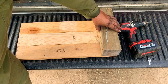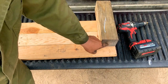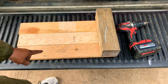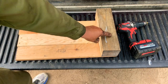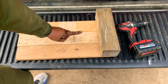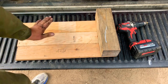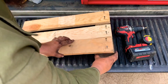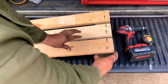What we're doing is screwing these three pieces of wood onto the four-by-four so it covers completely over them. This creates a platform where the tire rolls over and once it touches the four-by-four, because it's attached to the base pieces, it's not going to slide — the weight of the car is on those boards, keeping it from rolling further.